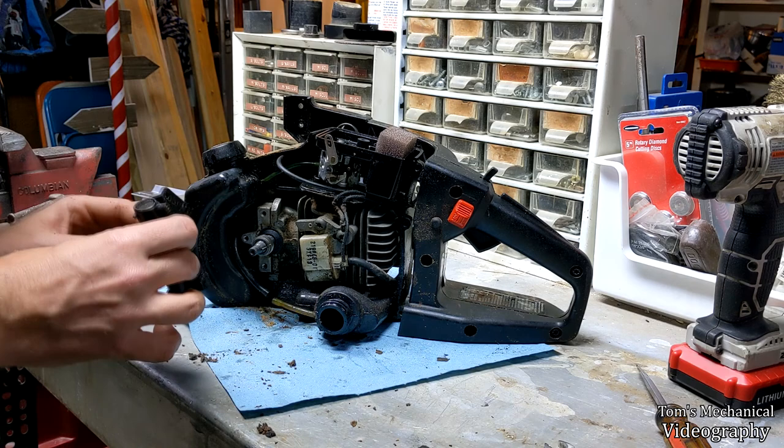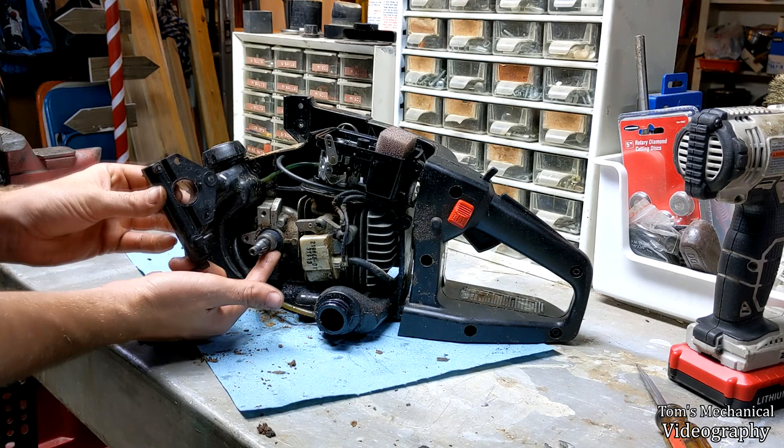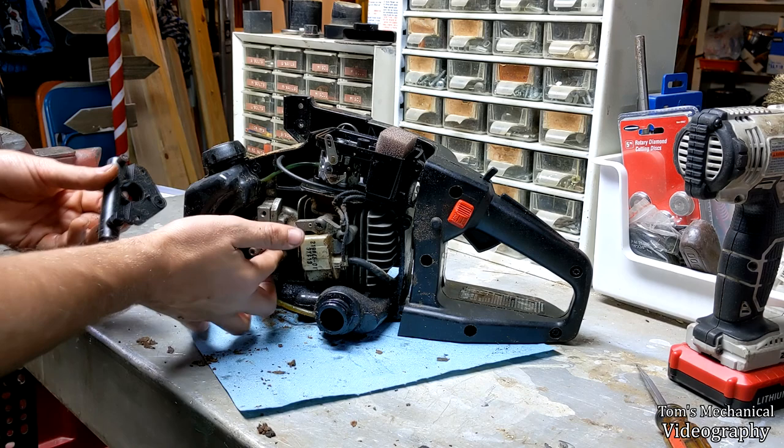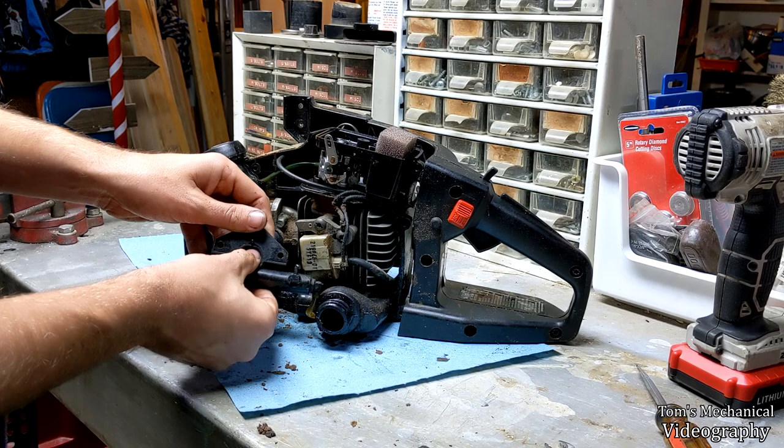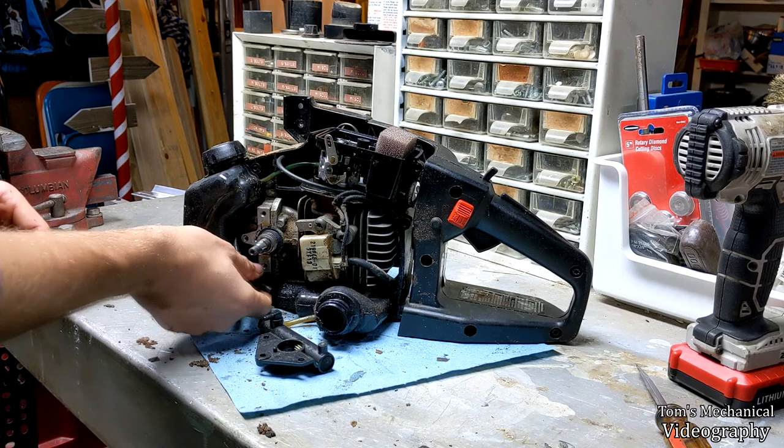And this right here, by the way, is your worm gear for this guy. So don't lose that. Well, it can't come off because of the key. So yeah, you really have to mess up to lose that. All right, now watch this. If I spin this, look at that. Oil comes out. So my oiler's fine. Yours may not be. Mine originally was not. That means I got a clog somewhere in this line, and I got to figure that out.